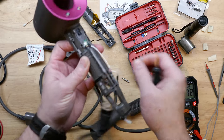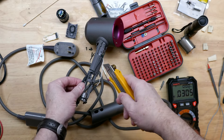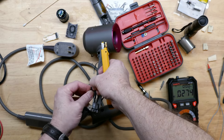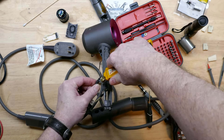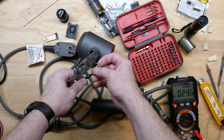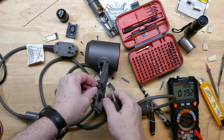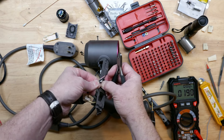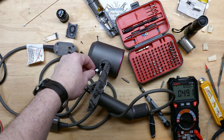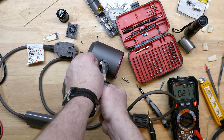I'm going to fast forward through some of this — I'll just take my razor knife and cut the heat shrink off; we'll have to put this back on later. Be very careful with these connectors because they are very tight and make a really good connection for their size. I've always tried to reuse them, even if I had to solder a wire on. I get the pliers and pull them — yeah, they're really tight, no latch, just a really tight quick connect.